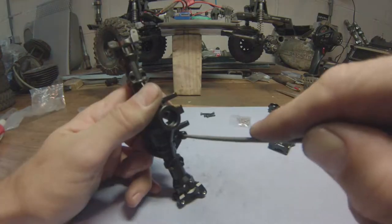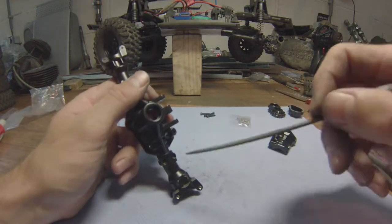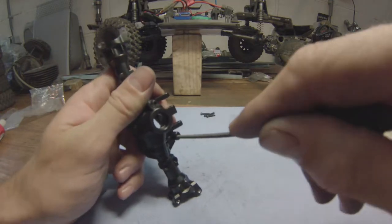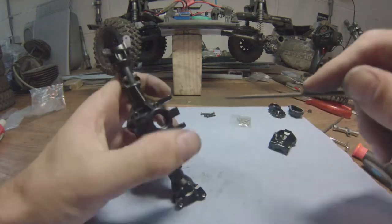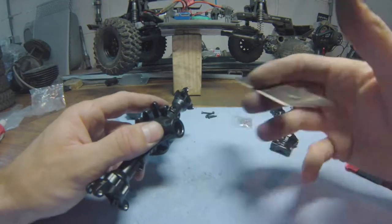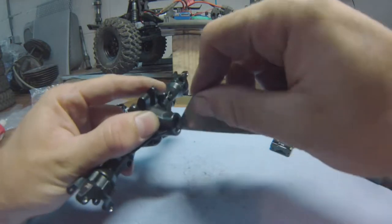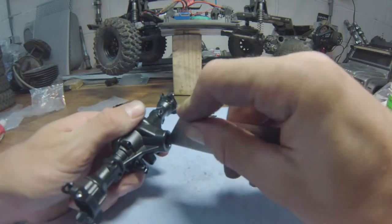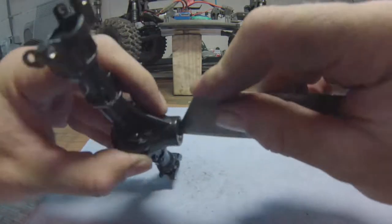There they are. If you remember, in the previous video I had a bit of trouble feeding the selector cable because of this part here, so here it goes. I'm pretty sure that the paint in here is going to do the same thing as with the front. It makes an extra layer that stops you from pressing the bearing in. Carefully get rid of that.